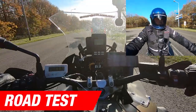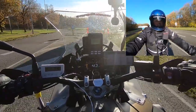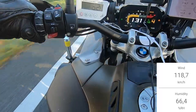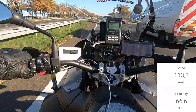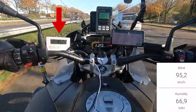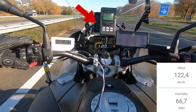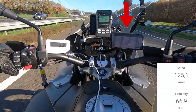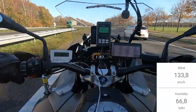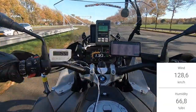Now for the main question: how does the Bullet perform on the road? We've given it to our rider with measuring instruments to check out how it all comes together. On the left monitor is the helmet's interior temperature in degrees Celsius; in the middle, a decibel meter for interior noise; on the right, the day's airspeed from a bike-mounted anemometer; and on the dash, rider speed and exterior temperature. We performed tests on long highway stretches at 130 km/h or 80 mph, taking averages over time. It was a nice autumn day, with average airspeed around 120 to 130 km/h and exterior temperature at about 16 degrees Celsius.